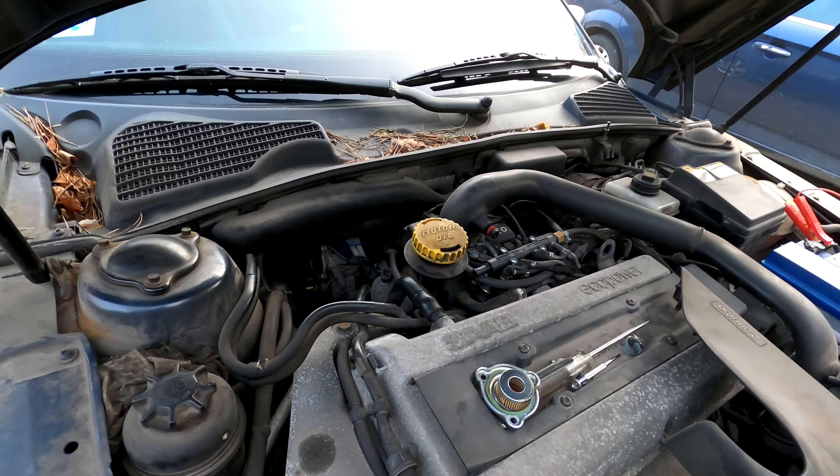Just to show you where the filters are located on this Saab — this small little thing is right there. It took me about three or four minutes to remove it, even though it's just three bolts. The problem was that I first had to loosen the bolts one by one slowly to drain all the LPG that was in the system. And there was a lot, even though I had closed the tank. And this nasty little thing was tucked away right down there — getting it out was a pain.